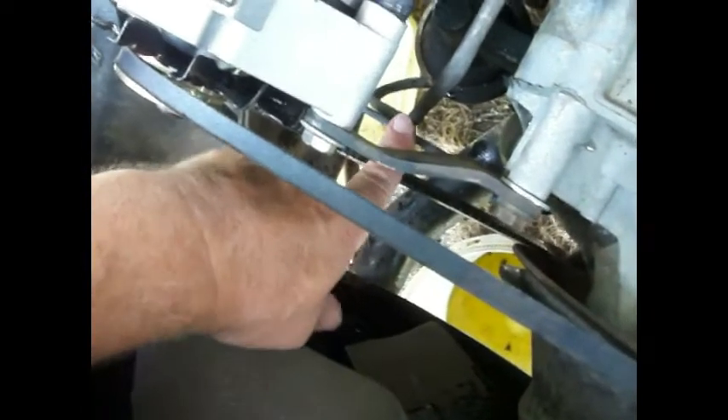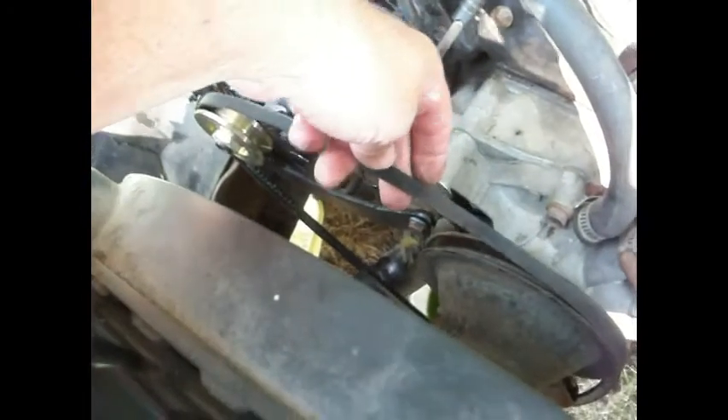Loosen her up and let's tighten her up a little. We're kind of against that fuel line too. So we may have to go get a belt an inch smaller. There's plenty of room for a belt an inch smaller - let's do that.